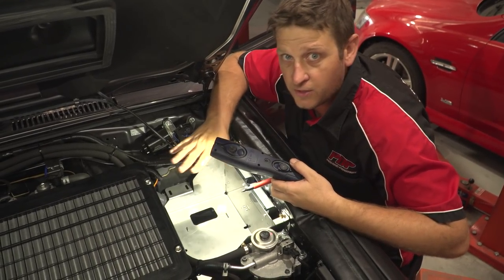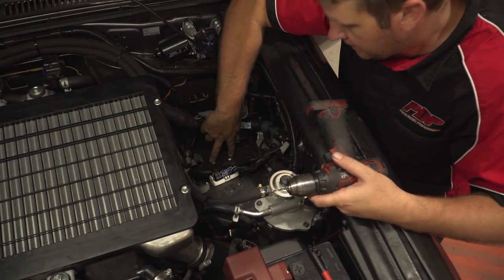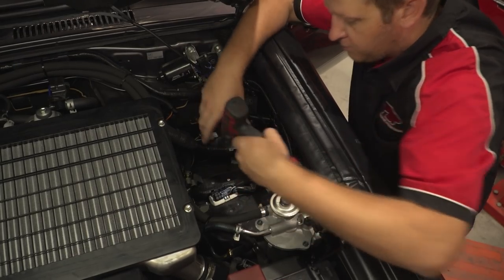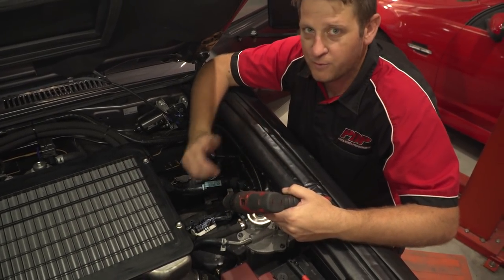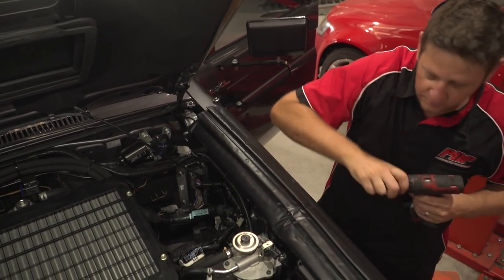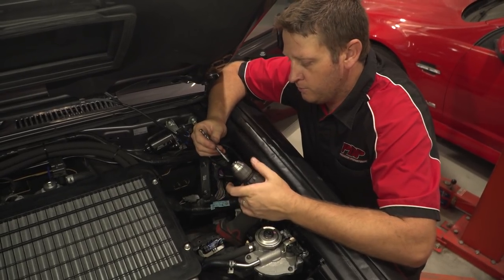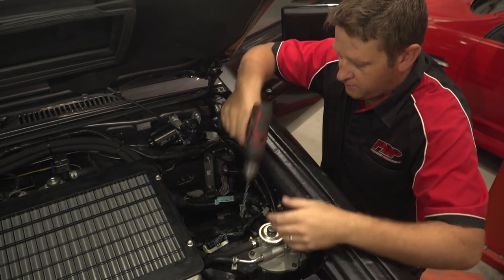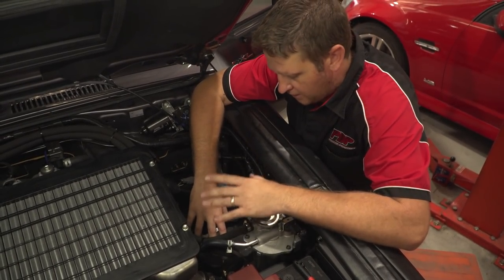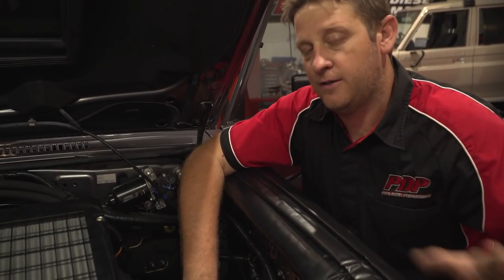The next step - once the tray goes back in, the tray stays in, so we don't want to do things twice. Come back over to the car where we've marked the holes to drill through the bodywork. We've got a pilot drill bit and we're going to drill four holes. Make sure on the other side you're not drilling through aftermarket shockies, hoses, or wires - factory there isn't anything, but if you've got accessories, be mindful. Once you've done your pilot hole, use an 8.5mm clearance hole for the M8 mounting. After drilling, deburr the holes, apply zinc rich primer, let that dry, then reinstall the tray.